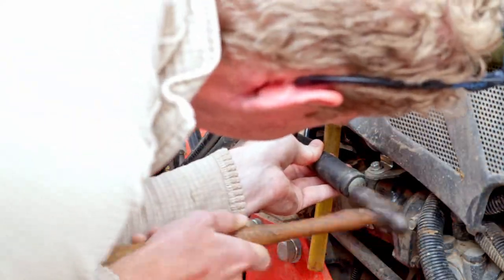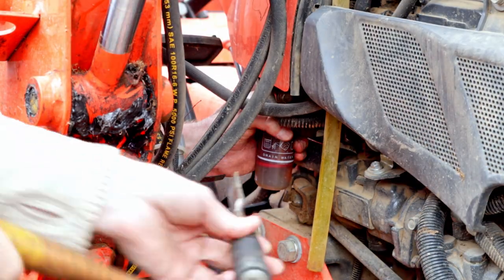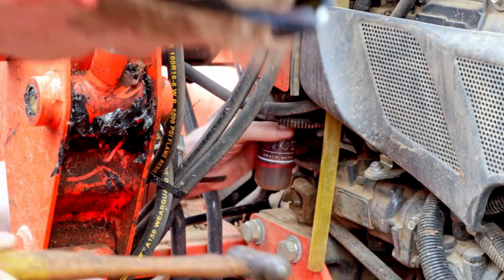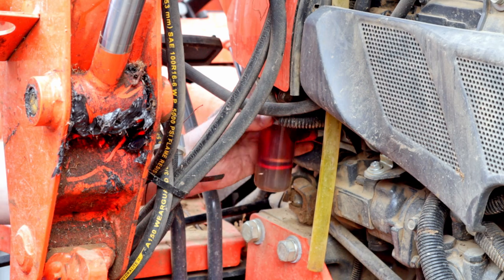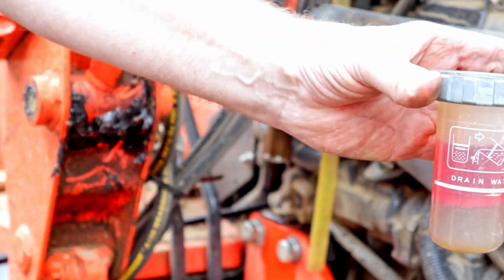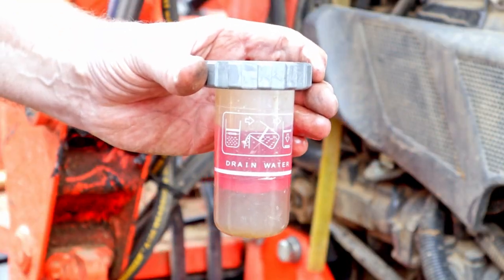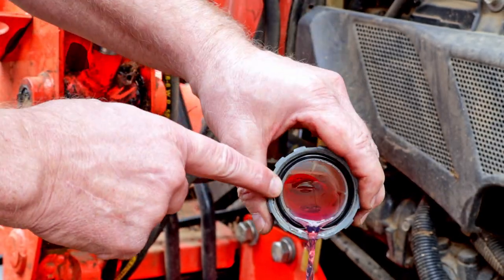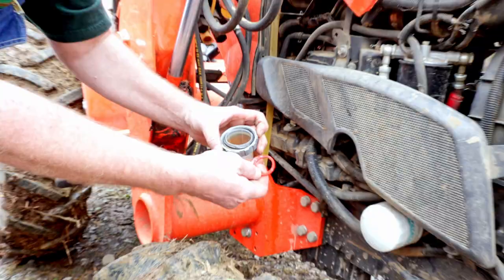The fuel supply petcock is located on top of this cup. If you disassemble it and it's not pouring out much fuel, you likely have an upstream issue if your petcock is open. You'll notice the clear line on the side of the cup, which is the maximum limit for water you want in it. Ours was right near it, so we thought this was causing our issue. When you pour it out, be careful not to lose the internal components.